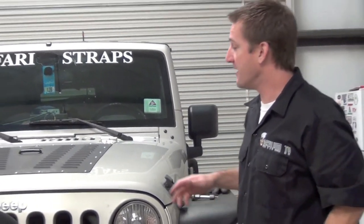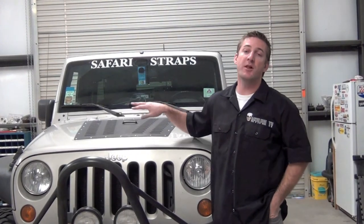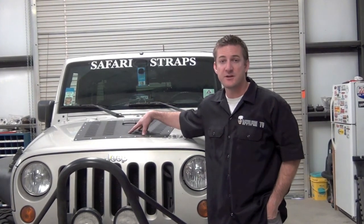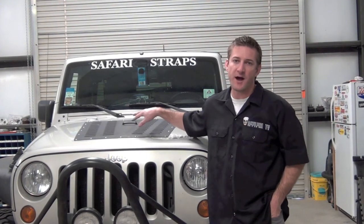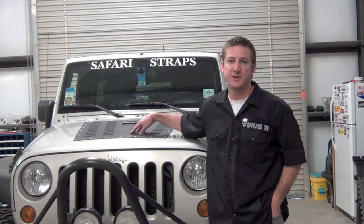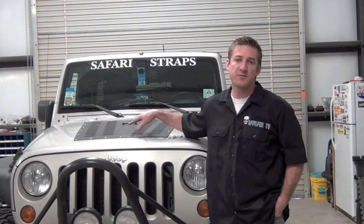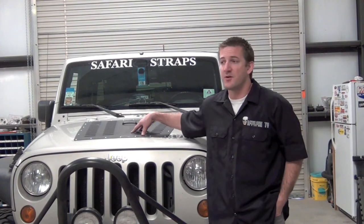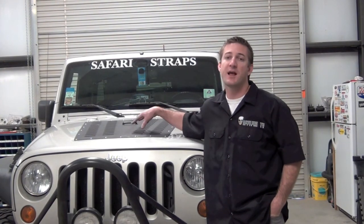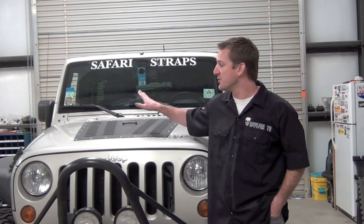Now we've got the hood back on — everything's painted, measured out, and secured. You do have your options: I went with flat black. You can order from Poly powder coated, but it'll come in more of a gloss, standard powder coat finish. I love flat black, so I ordered the raw version, took it home, and painted it with an automotive high heat paint — since we're going over the engine block, I chose that specifically. Standard high heat paints hold up to about 500 degrees; higher-end ones go 750 to 1,200. The Rust-Oleum automotive high heat can withstand up to 2,000 degrees. So while our engine's running hot, we're covered. If anything happens — say you puke some fluid on the manifold and it sparks up — you're going to have some time to get out your fire extinguisher before this thing's ruined.